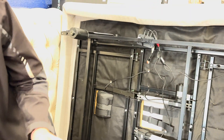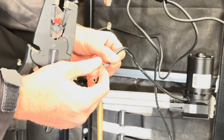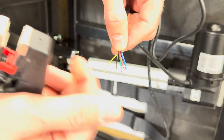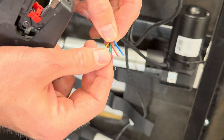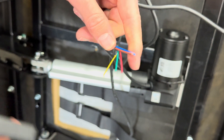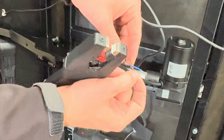I've got a cheap pair of lever cutters or wire cutters — on Amazon they were about $15. These are really nice because they allow you to strip back the entire casing without cutting into the wires underneath. Depending on the bed you'll have a few different cords — generally three, four, five, six, or seven is pretty common. The tricky thing is we don't know which wires control the up and the down; all the others are superfluous. Sometimes thicker wires — like the blue and brown here — are most likely going to control the head and foot. Strip back about a half inch to expose enough metal to connect into the lever nuts without the teeth closing down onto the plastic.